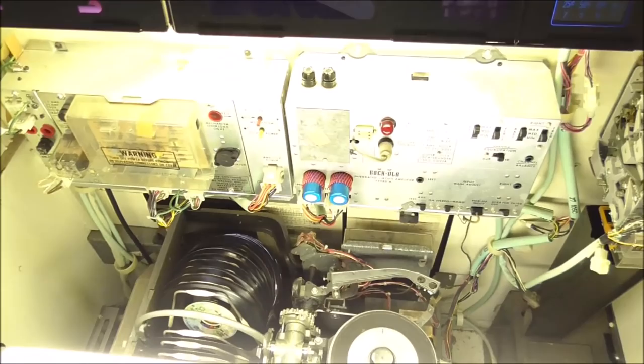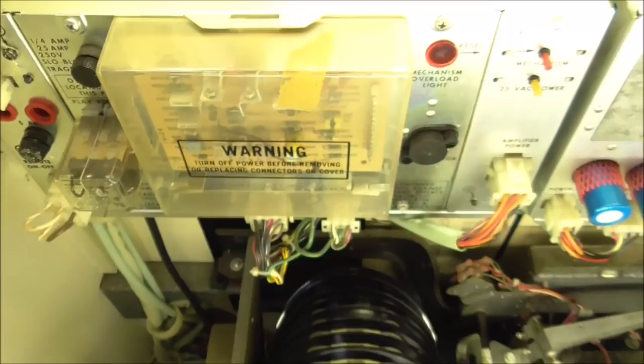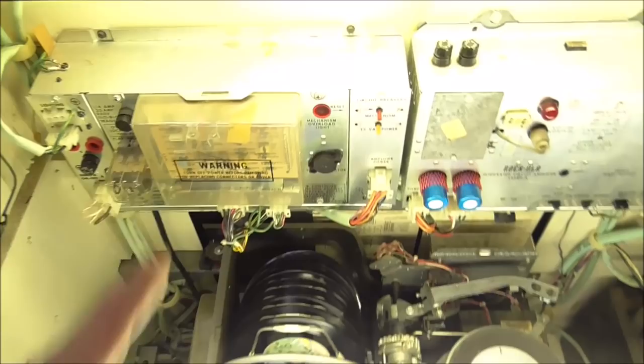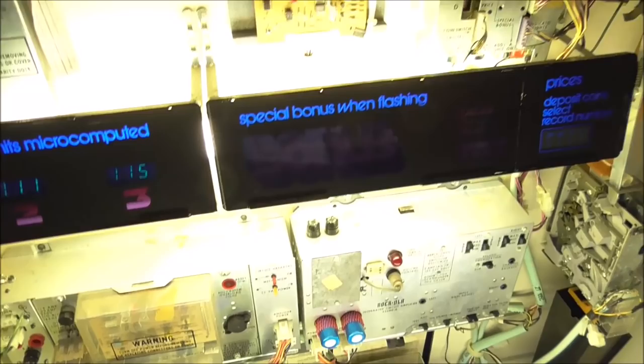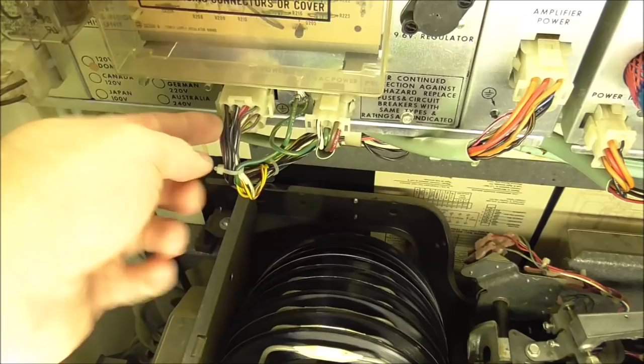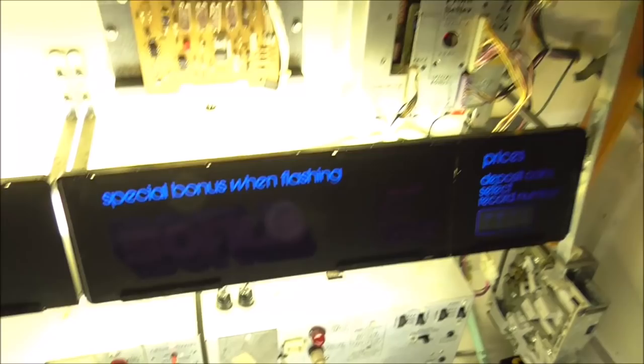After all, these were designed to make money. The power comes in to the box and goes up here to the power supply. Your main thing to look at on these Rockolas is there are three little LEDs in there — you want those LEDs to be lit up, giving you your 32 volts, 21 volts, and your 9.6 volts. The 9.6 volts is what runs this Profit Setter — it says '9.6 volt' right on it, and it likes being right at 9.6. There's a little adjustment on there. You test on the pink wire — you want it to be about 9.6. If you're off too much, the Profit Setter will start doing weird stuff.